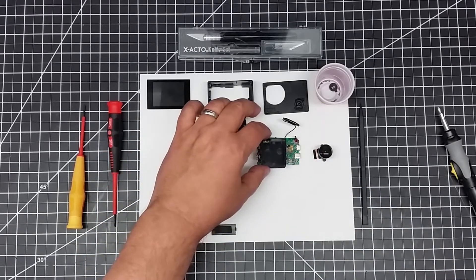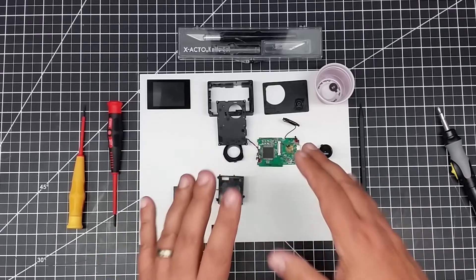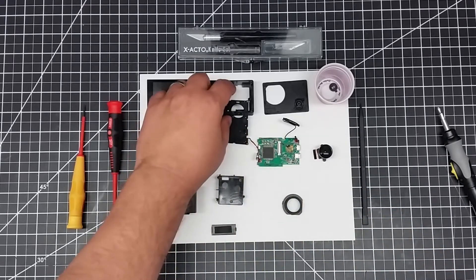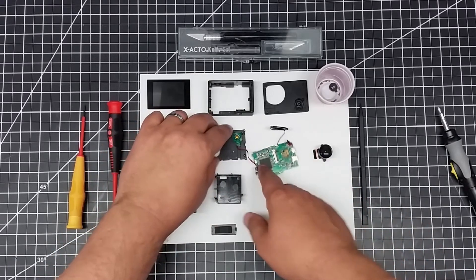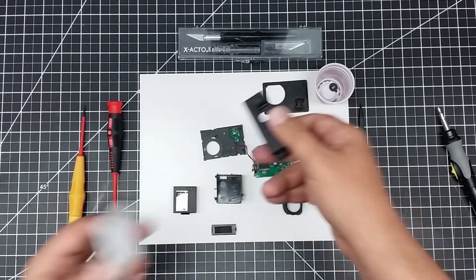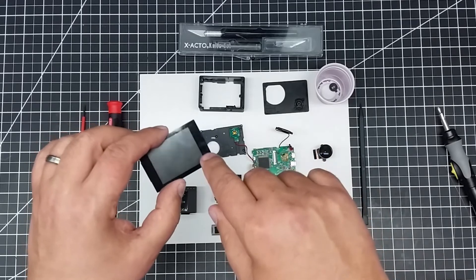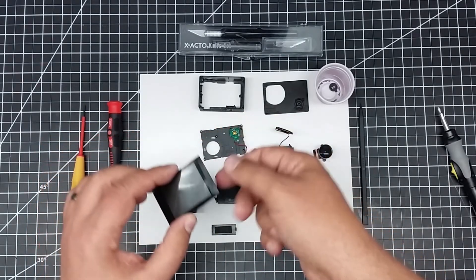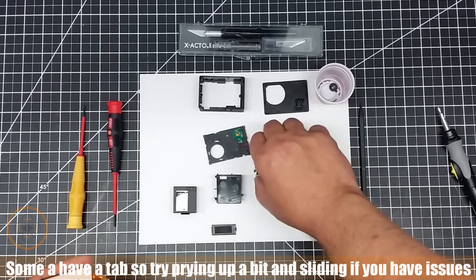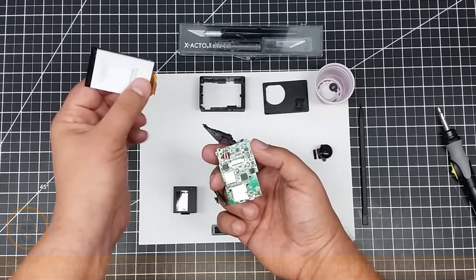Typically the battery bay is sitting on top, so you'll remove it with the battery bay still attached, because the screws actually come from underneath. Now the key piece is to remove this from the case — you'll need to actually separate it from the LCD screen, and this is what gets a little bit confusing. The LCD screen's bezel simply glues to the back and sits on these tabs, so only glue holds it in. Take the X-Acto knife and work it underneath the thick edges to pop it up so you can get a regular screwdriver underneath it. This will just pop up, exposing the ribbon cable, and then on the back there's a connector — you simply move the ribbon connector forward, and boom, you can pop this out.